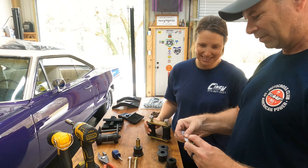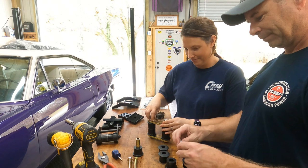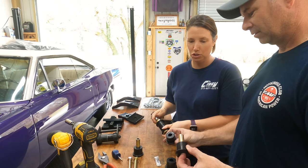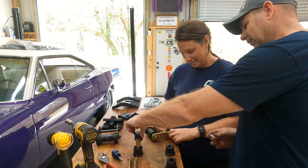Polyurethane squeaks really bad if you don't lube it correctly — like your son's truck. Put some on the inside. We didn't come with directions, but I'm going to assume anywhere the polyurethane is touching the body needs lube. We'll press these up through the frame of the car.